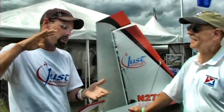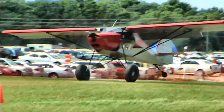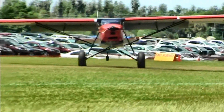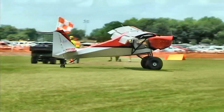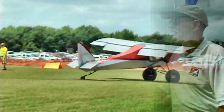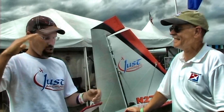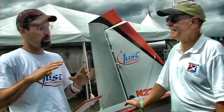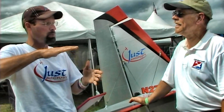Another added value with the shocks is that once the suspension compresses, the center of gravity of the airplane gets really low, so braking power is extreme — much higher. This morning I was landing with the brakes, the tires were locked up on wet grass and they just slid to a stop with no risk of nosing over. On my place with a 20-degree slope, I hit, the suspension compresses, I'm under major braking, and by the time the suspension starts unloading I'm off the brakes, the tail's coming up, and then it's done.